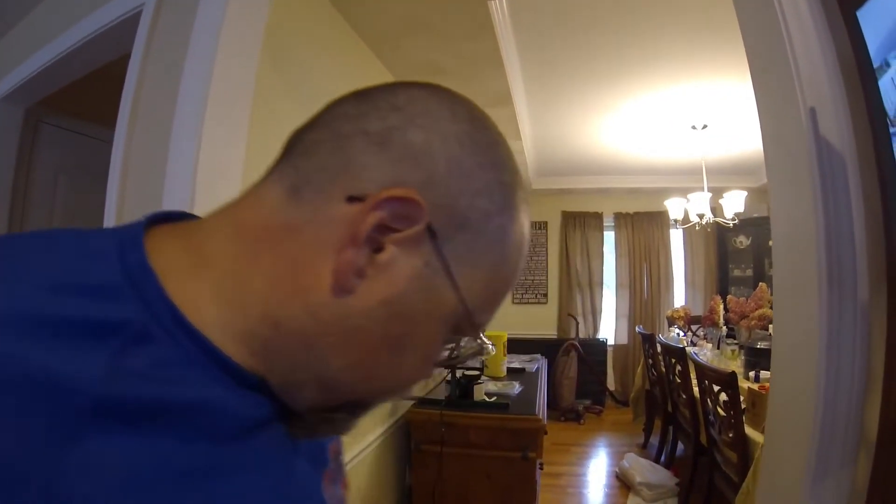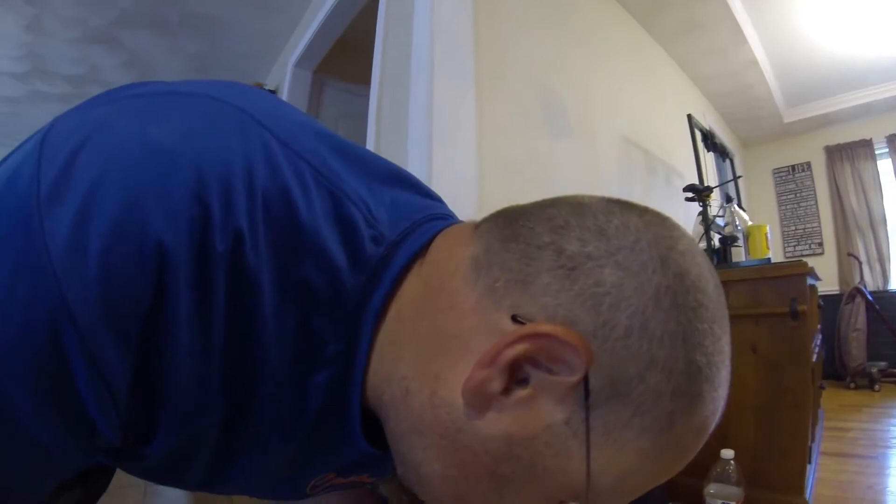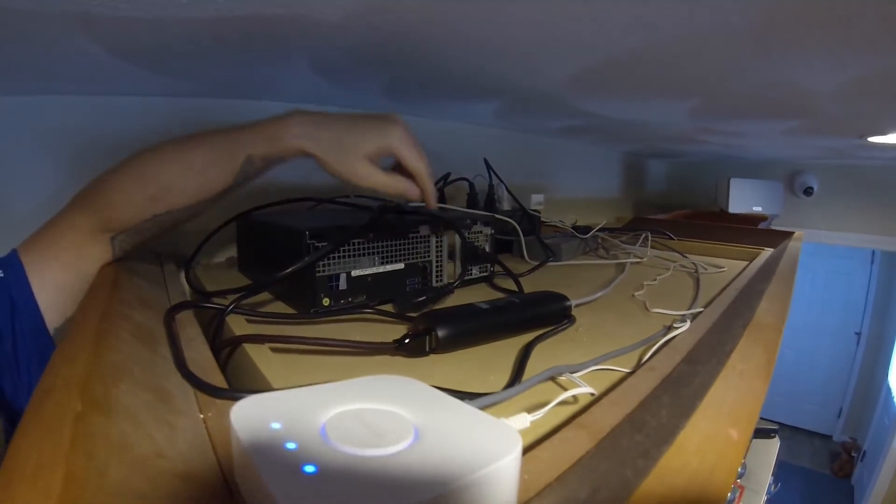So that's my experience. This was the DVI to HDMI cable — just going to use the string to pull it back through the hole. The viewport did not like that at all. This is the cheap HDMI cable — viewport didn't like that either. So you need a quality HDMI, and it's got to be native HDMI to HDMI. If you're trying to convert it to DVI, I know it didn't work. Imagine trying to convert HDMI to VGA — probably not going to be happy about that either. Otherwise, I'm pretty happy with the viewport. There she is, plugged in and ready to go. This is the old computer with the 10-gig NIC in it. Hope that helps everyone. Thanks for watching.